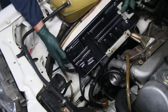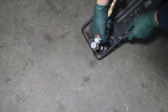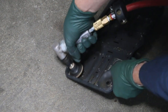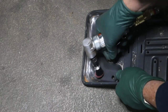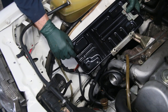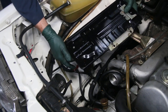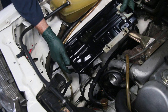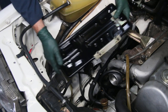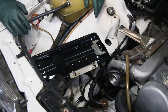The battery box tray is restored and I'm really proud of how this came out. I went after that rust area with one of my favorite die grinders and scouring pad attachments — starting with a big one to get the heavy rust off, then a narrow one to get along inside the crack, and small pads to get into the corners. Once that was done, I coated it with Miracle Paint, let it sit overnight, buffed and lightly sanded that area, then sprayed the entire tray. I'll put a link in the video description below for the paint I use. I'm not going to bolt it down yet because there are a couple more things I want to do in the engine compartment before reinstalling the battery.